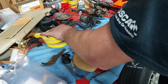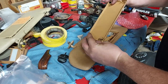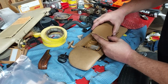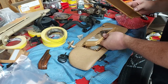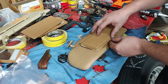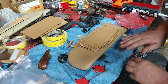The radio is in and the actuator flaps are working. Now we're going to glue back the wood trim piece. The final thing: I noticed the visor mirror frame had cracked. This is so common on the 123 — the frame cracks where these little pegs plug in. I already have a stockpile of original visor inserts; this one's in perfect condition. I can remove the broken piece, solder in the connections, and put in a good working insert.